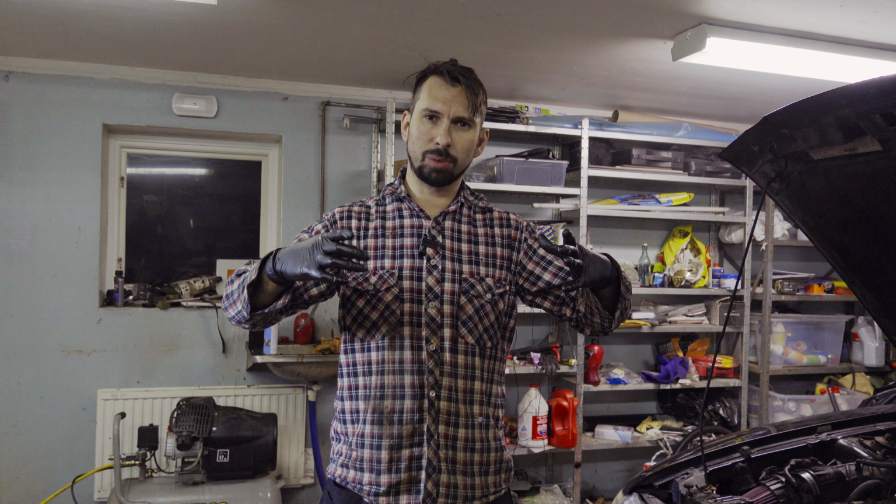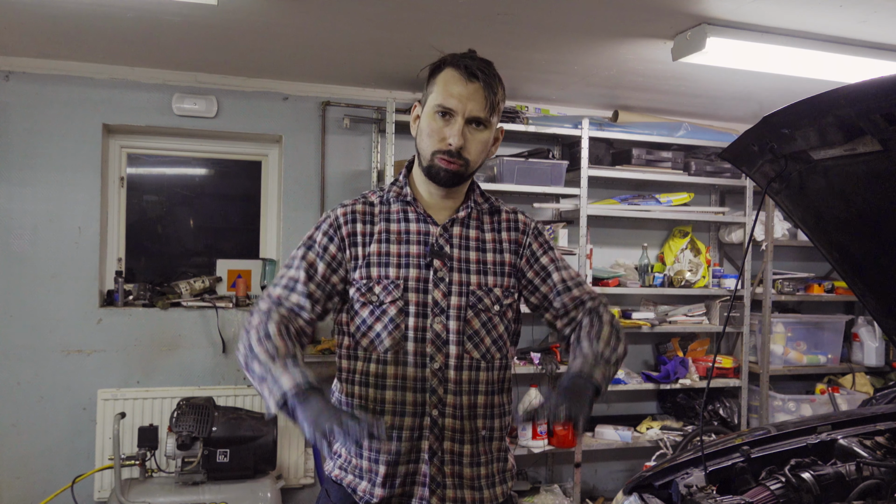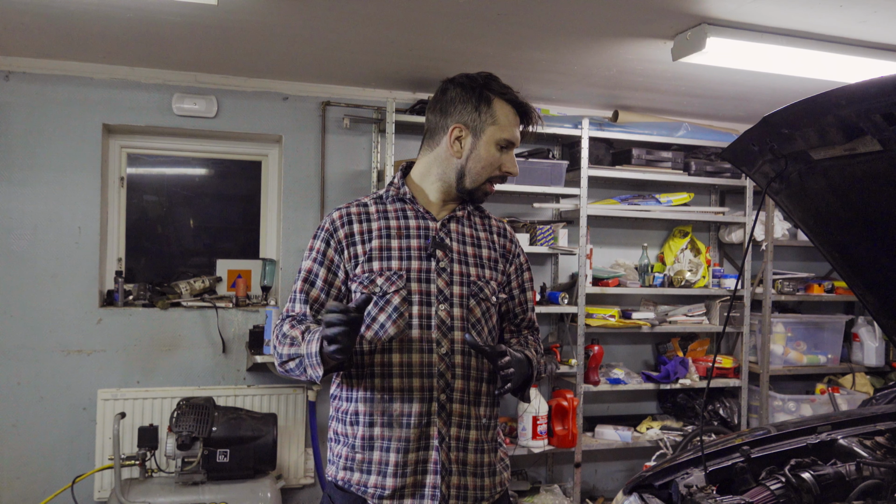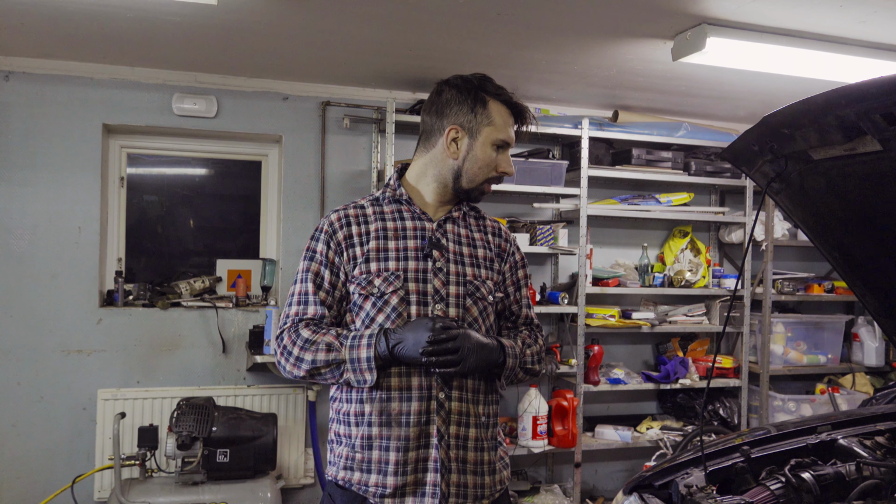Well, what could I say? That turned out to be quite an adventure. If you don't try new things, you don't learn stuff. Trial and error, I suppose. I worked with a funnel, and I actually took a bigger funnel because as the engine warmed up and I revved the engine, coolant kind of was pushed out, and then I guess when the thermostat opened, the coolant goes down. So you kind of need an amount in the funnel to get it out, or to have a proper level to get the coolant into the system in the engine.